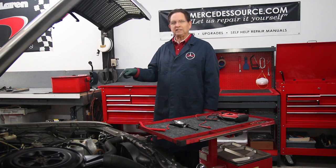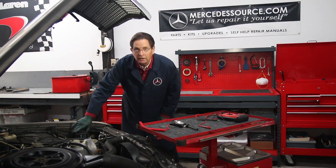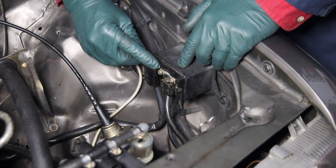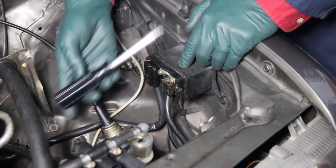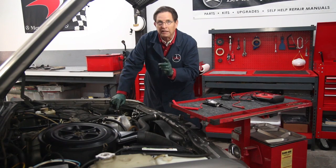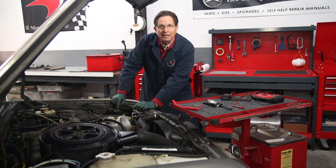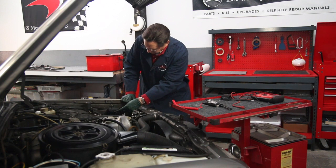The first thing is you want to look inside the glow systems relay box. Most of these are located right here on the left front in the inner fender panel. Remove the cover. They all have, at least up through the early 90s, a strip fuse located right here. I've seen at least a dozen times where this strip fuse has cracked — it hasn't burned out, it's just cracked and it may make contact. If you push on it, you'll notice it's moving. This happens in winter because of a combination of metal fatigue, engine vibration, and cold temperatures, which cause this little strip fuse to crack.